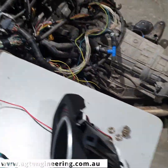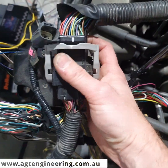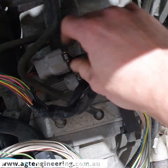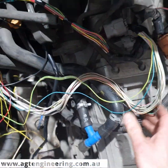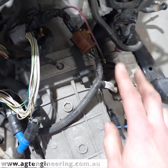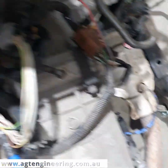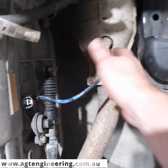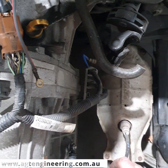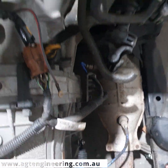The harness is made up to the Australian engine. Mainly all the engine wiring goes through this big 54-pin plug, and these two down here are for the transmission. This extra plug on the six-cylinders does your four O2 sensors — two each side, one pre-cat and one post-cat. On this one the customer is not going to run the cats, so we've deleted the codes for the rear O2 sensors and you can see they're not connected.